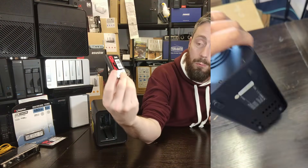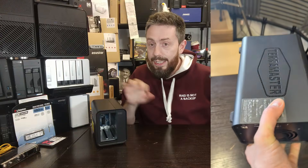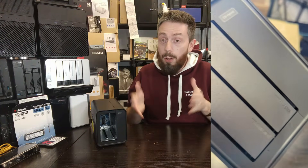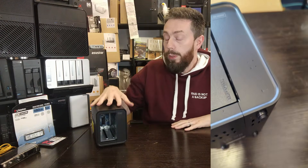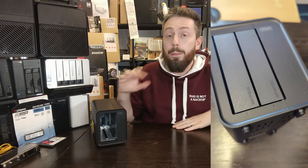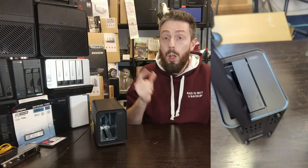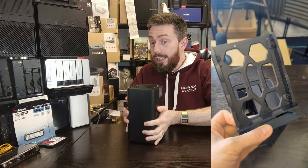You can install one drive or two. We're using Kingston DC 600M enterprise-grade SATA SSDs in this video. Standard hard drives can go all the way up to 24TB. During performance testing we installed two Seagate 24TB IronWolf Pro hard drives in a RAID 1 environment, and it worked straight away.